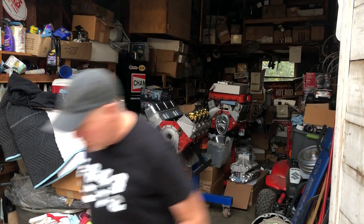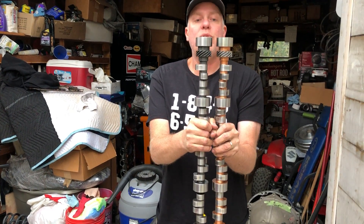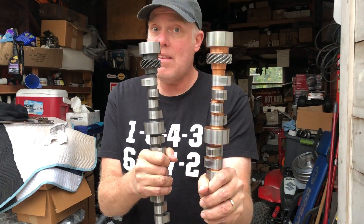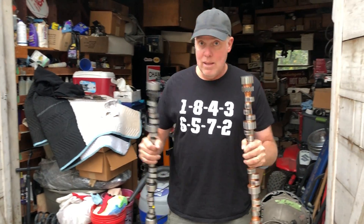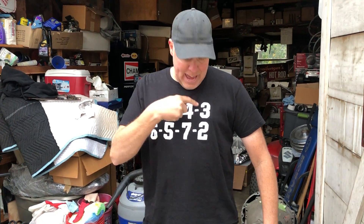The thing is, you can change that up by doing nothing but changing the camshaft. These are two big block Chevrolet camshafts for different firing orders. If you study them carefully you can see that the very top lobe is in a different place — that's because this camshaft is for a 4 and 7 swap. What you can do is take any one of these companion cylinders and rearrange the lobes on the camshaft to change whether each cylinder is on the compression stroke going down for power or on the exhaust stroke. Swapping 4 and 7 is very common for old Chevys. If you also swap 3 and 2, you get an LS firing order.